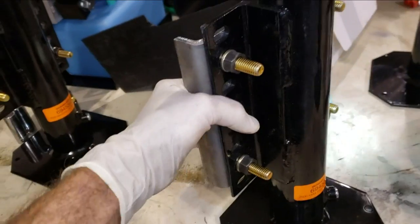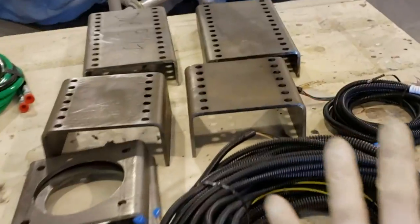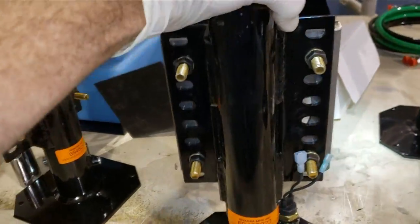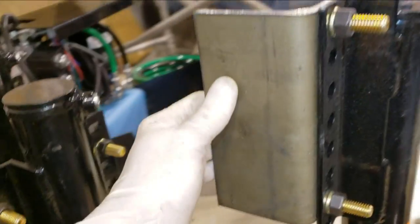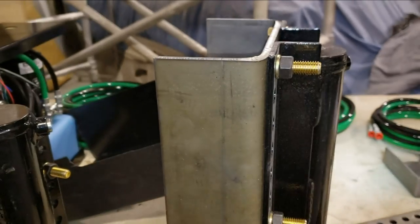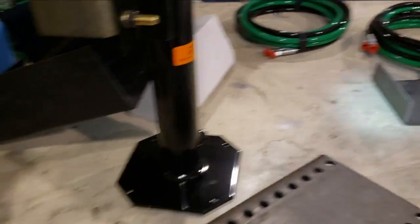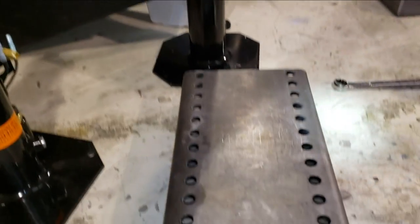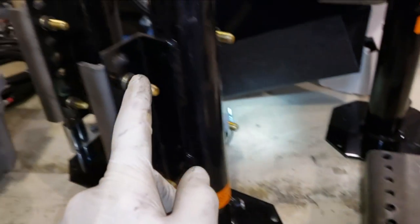I think I figured out that I'm gonna go with these mounts - they also came with it. They came with like three sets of mounts so these will work in the front. If I assemble the jack first it'll be easier to keep them positioned and weld on. They told me to use these mounts in the back but that's way too wide, it's gonna hit. I don't have any room for the tanks that are back there, so I'm gonna have to switch to what they were calling the front jack mounts. But I do have to cut the old mounts off in order for these to even work.